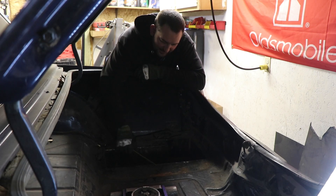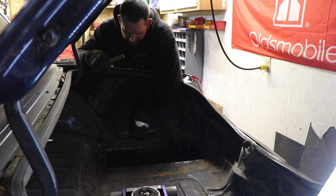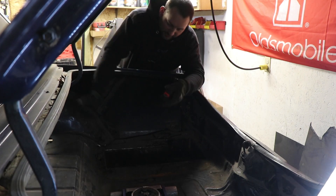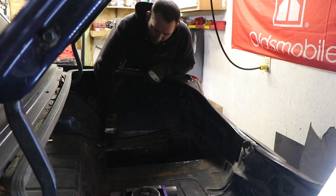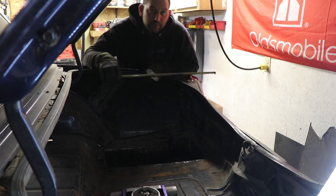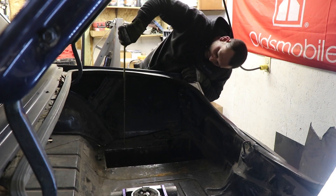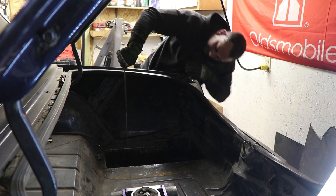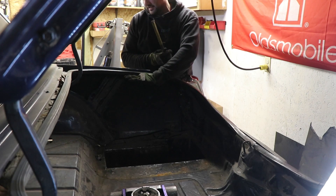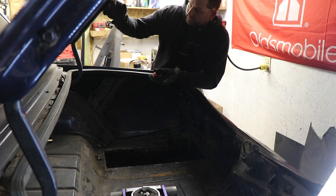I have about 16 inches from where I still have clearance to the gas tank over to the frame rail. The problem is the frame rail comes in about 2.5-3 inches toward the front - not such a big deal for the tire since it'll be in an arc, but going down 10 inches that's quite a bit. The wheel package is around 26 inches tall, and from the top of the stock trunk floor is about 16 inches, so with a 10-inch drop that comes out to 26, with about an inch and three-quarters of trunk lid that comes down.